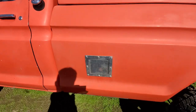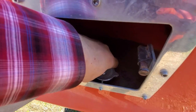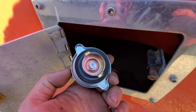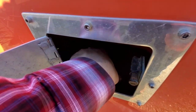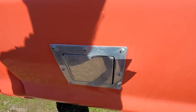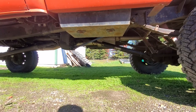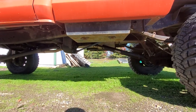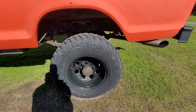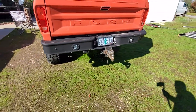At least everything closes. So these are those aftermarket tanks. They were originally running almost like a lawnmower cap — these are actually a cap pulled from Stant. These are actually the oil cap for an IDI truck, a 6.9-liter — I think it was just the 6.9, not the early 7.3. Little magnet covers, nothing big. Both side saddle tanks down low. You get a really good view of that driveline, which I think has turned out fairly good. This does have airbags in it — I need to put the extensions on here, I'll be doing that today. Custom exhaust out either side turned out very well. We run a pintle hitch for the camper trailer.